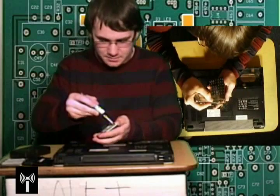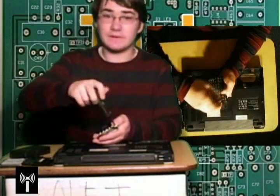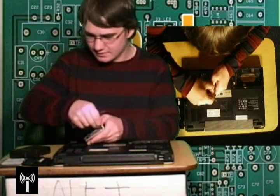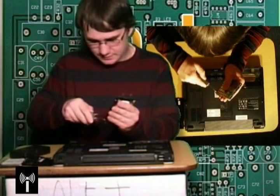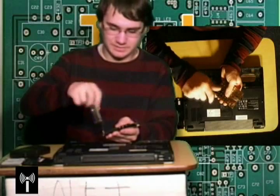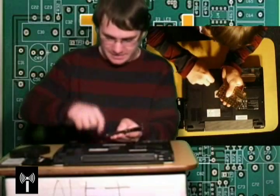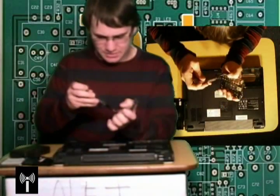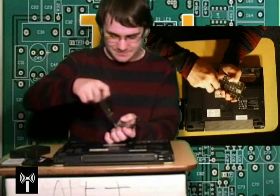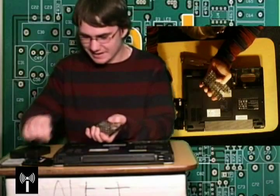To remove that, there's going to be four screws, just like when removing the external hard drive from its casing. You want to take the four screws out with an appropriate screwdriver — a non-magnetic screwdriver, preferably, I should mention — because magnets and hard drives don't mix, so you don't want to be messing around with a magnetic screwdriver. Just a word of advice there; I've messed it up a few times. Fortunately nothing bad happened, but it could have.